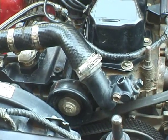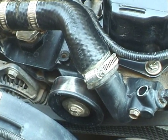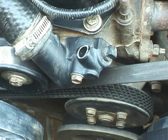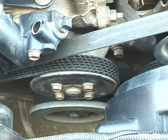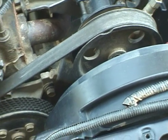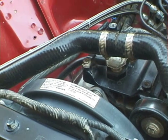I'm running a 195 thermostat. If we peek down here you can see the idler air pulley. It's a non-air-conditioning serpentine belt. I do not run a mechanical fan — I have two electric fans: the original stock fan and a secondary fan. They are both on switches and relays of course. There's the upper radiator hose.